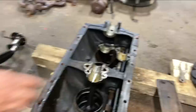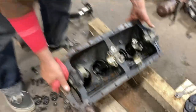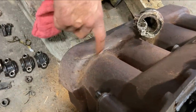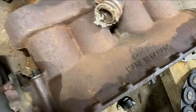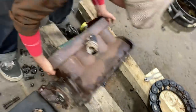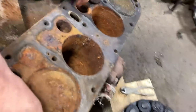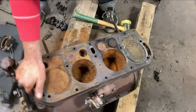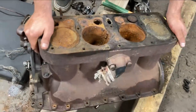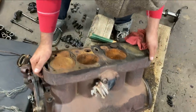Give this engine a flip. Looking at it from this side you might think, wow, what a great buildable engine — but when we flip it to the sad side, we've got water damage. This is a red flag. We don't even need a MagnaFlux situation here, you can see plain as day. This is neat though — made in Canada. The valves have actually rusted off. It looks like barnacles. Those valves are probably stuck, kind of like that Model A motor we took apart.